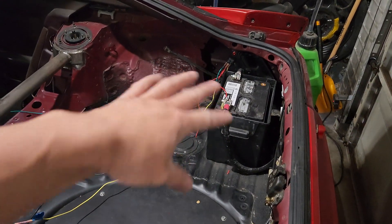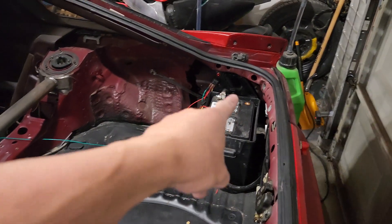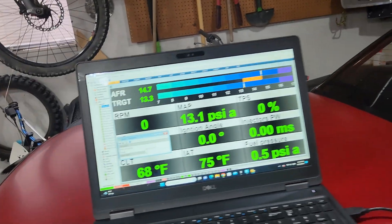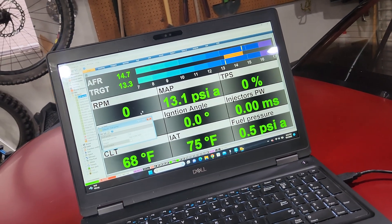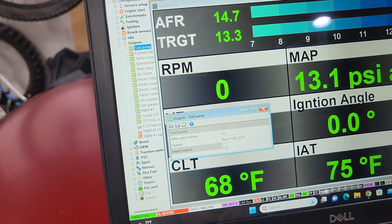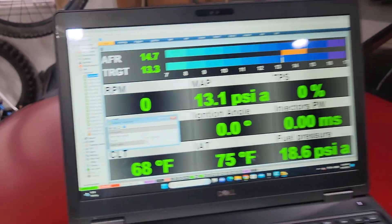I've already got this running in my car — I'll take it to the back. Don't mind the mess; wires are going everywhere on purpose just to show you which wire goes to what. There's the relay right there, just using a 40-amp relay. I'll tell you exactly which wires go where. Here is my ECU software — the EMU Classic software, same for the black and the classic. I've got my output pulled up on auxiliary one and I'm going to invert it.